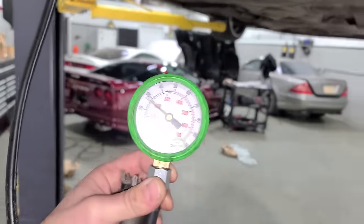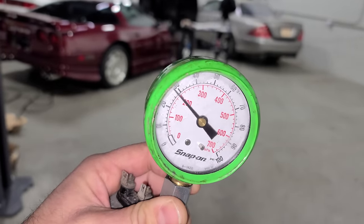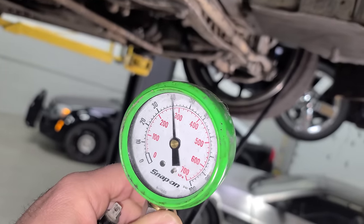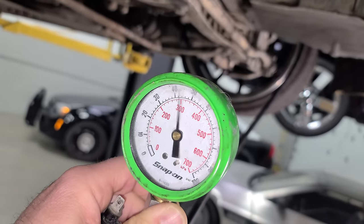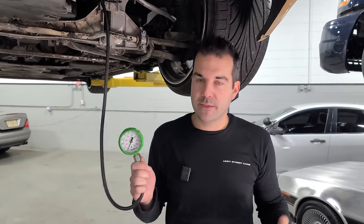After starting the car, the gauge reads about 30 psi at cold idle — it's accurate. At 3,000 RPM we're getting about 45 psi when it's cold. So 30 psi at cold start going up to 45 psi at 3,000 RPM — not super alarming. But to throw a wrench into this whole situation, on my last highway cruise at operating temperature it was showing like about 10 or 11 psi. That is what really has me concerned.